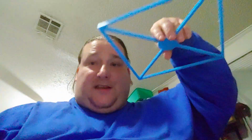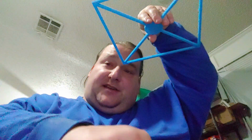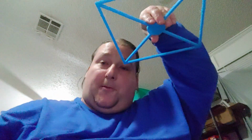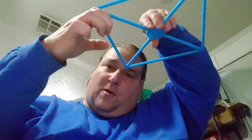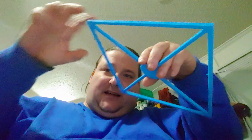So with a Delta printer, there is no XY plane like there is on a Cartesian plane. It doesn't exist. There isn't an XY plane. What there is, is a mathematically generated XY plane that is virtual, based on the motion of all 3 motors. So for a Delta printer, you're printing down here, but you're homing up here because you're using 3 arms that move up and down, and you can't really home the arms down because it's a Delta, so the arms are at an angle. So the carriage, arm carriage, can't go all the way down. It's going to come down like this and be at an angle.